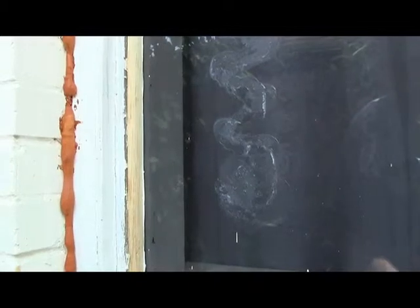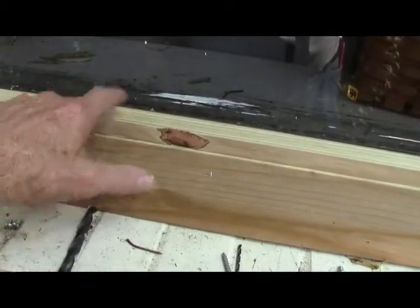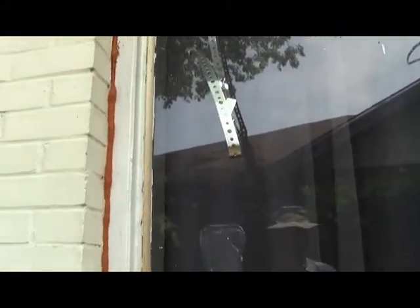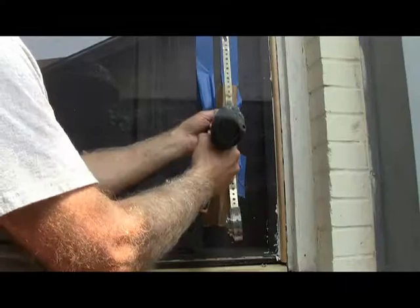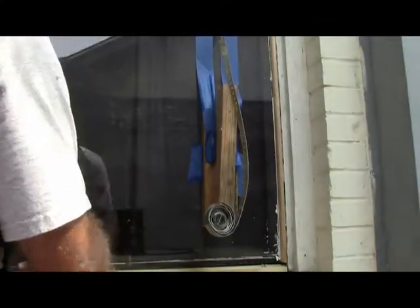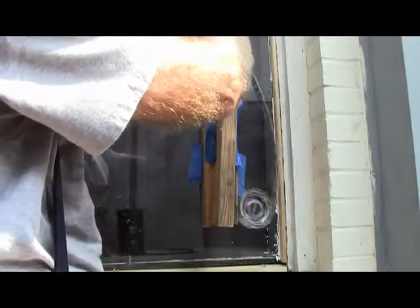This silicone has set up from last night, so we know this glass is not going to slide down — well, it will slide down over the years, but it'll take several years. I've got a new piece cut that made up the difference; we took out that little shallow piece and put the bigger one in because now we've got the window all the way up. We've got our trim all the way around the window. We've got the section with the U-clamp pulled off the window — we just need to take this last one off.